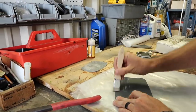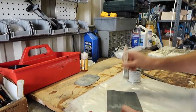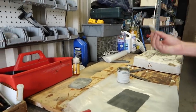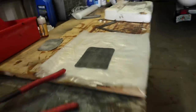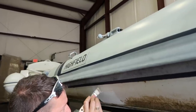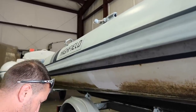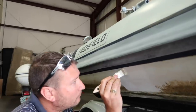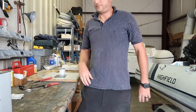Yeah, that's another thing — I was kind of globbing it on. Does temperature and humidity have a lot to do with it? One hundred percent. With Hypalon you want to keep your humidity under 70% — we're at 61 right now. If it was 75%, you'd pull it inside and shut the doors. After it cures, you can take acetone and get that extra glue off the next day, otherwise it'll turn a mustard yellow. With the trimmed bristles you can really pull and stretch the glue. While we wait 10 minutes, we'll start grinding up front.